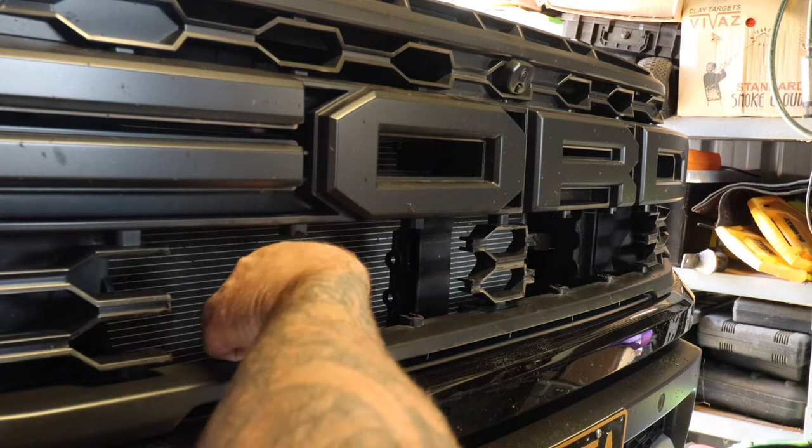So essentially what I'm going to use to connect the trigger wire for the lights to the Ford wire, I've got these kits here. So basically these are waterproof, and they've also got the solder and everything built in, so I can just run both wires in, heat that up, the solder will melt around it and also make it waterproof, and then I'll put heat shrink over the top.